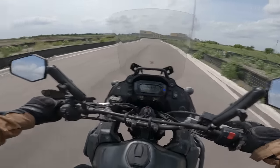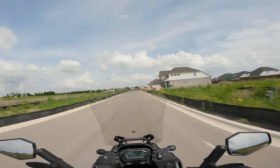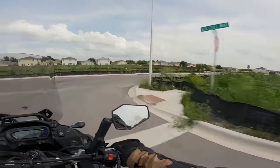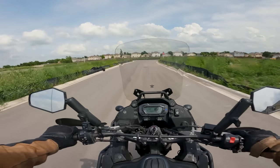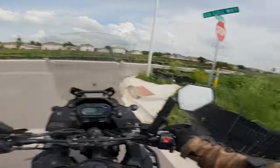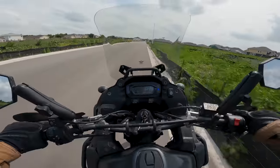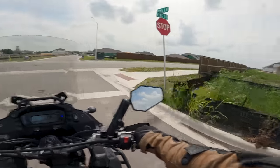Now it's time to see if all this work made the difference. There is definitely an improvement in having properly bedded brakes — there's such a nice extra bite out of the brakes. However, it hasn't solved my issue at the lever; it doesn't feel like the lever is telling me what's going on. I'm just knowing what's happening because I've ridden this bike for a year. Nice light touches is all I need to really bite down now, and I'm getting great bite out of these pads. But it has not solved the problem of my lever feeling kind of numb — I still feel like I have to yank it to really know what's going on. Let's do that last mod.